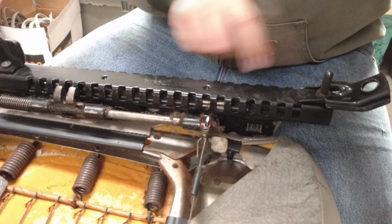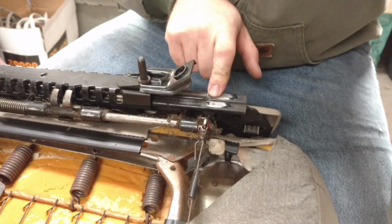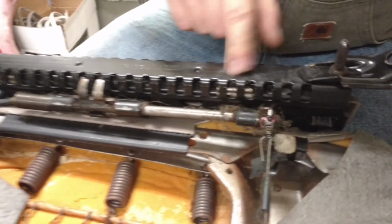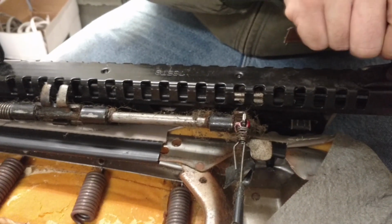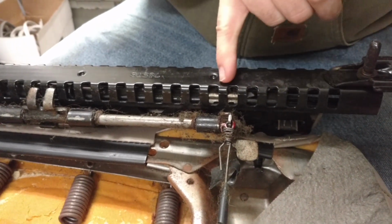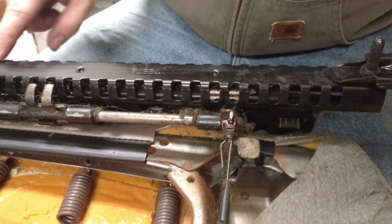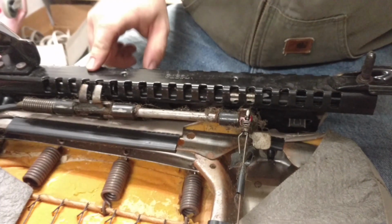Alright, I'm finding that grinding these off alone is not enough. This little dimple here actually hits the bearing inside that cage, as you can see, so it can't slide off. So I'm going to take the side grinder and I'm going to make 2 slits here to cut that dimple out of this rail. This whole rail is going to get salvaged or scrapped anyhow.